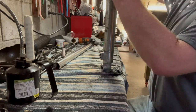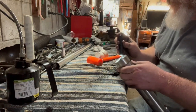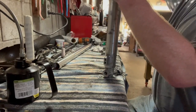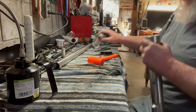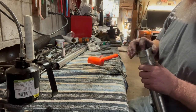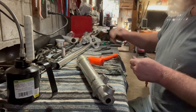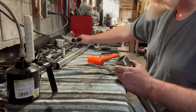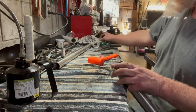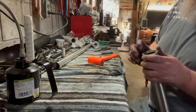It's about seated. Fork seal seated — sorry for the lighting. We just got through a really nasty ice storm here in the north and we're living off a generator right now, so I don't have the best lighting. Retaining washer goes in after the seal, and retaining clip goes in after the washer.